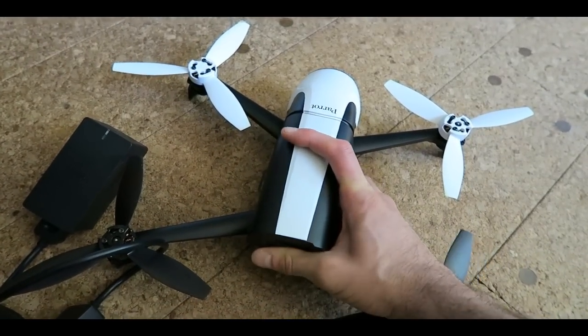After you're done flying and want to upload your footage, here's what you do: get the USB cable, take this part and plug it into the small port on the drone, then plug the other end into your computer. The biggest mistake people make is they don't plug the battery all the way in and forget to turn the device on. If the device is not on, it won't transfer any pictures — so you must have it on, then plug it into the computer.